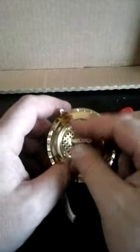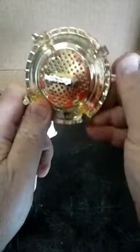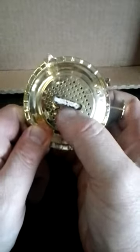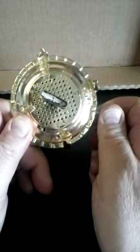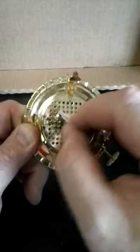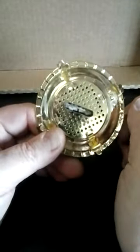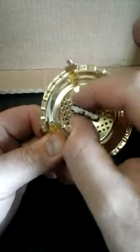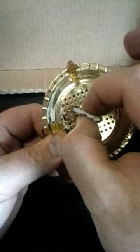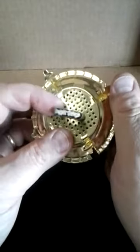Here's what I found with the one that wasn't burning so good. If you can see it, the wick slides up and down here. This one is quite loose — you'll see a gap. The wick is slopping around inside the guide. On the better one that was burning much better, this was a much tighter fit. The metal plates were clamping the wick much better. That was the only difference I could see. So I started playing around with the one that wasn't burning so good, and that's what made a massive difference.